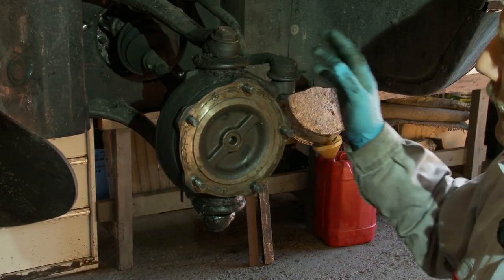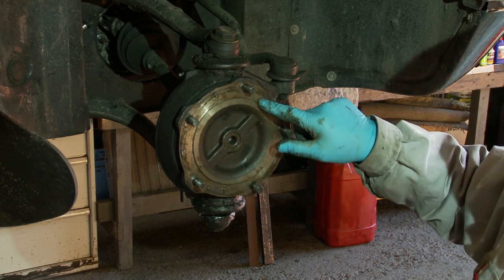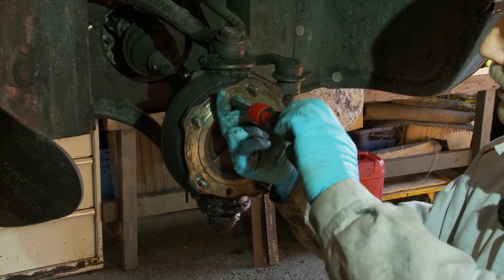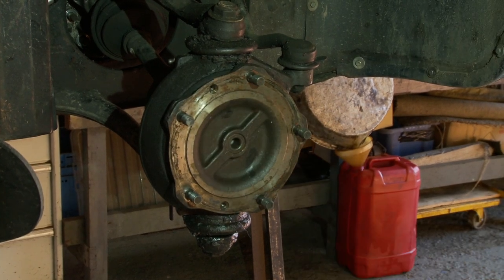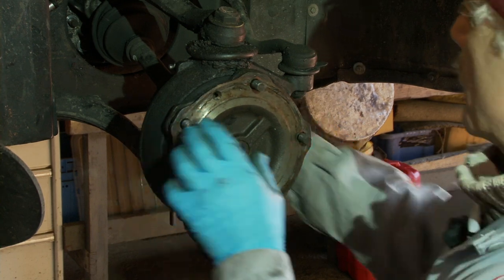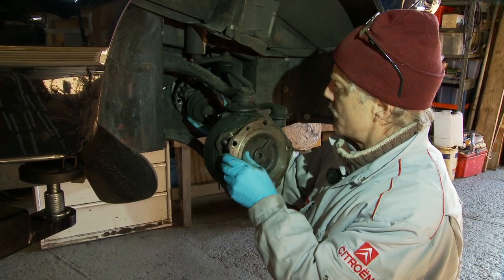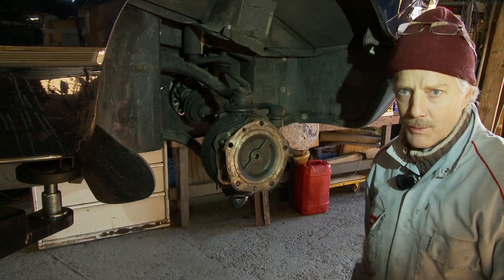In order to remove the drive shaft, the hub is held — the drive shaft plate is held onto the hub with two screws. These have to be removed to allow the drive shaft to slide away from the gearbox so we can take the engine and gearbox out. The whole drive shaft can slide through the hub, so I'm pulling it off so the drive shaft comes off the studs on the engine side. Drive shaft is now free and we can get the engine and gearbox out the top.